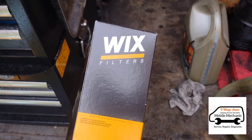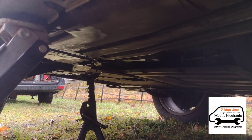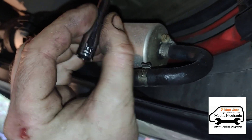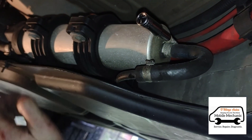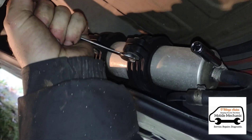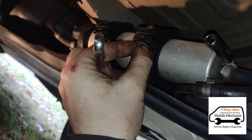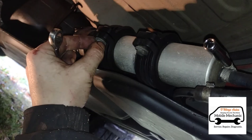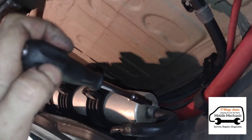Lastly, we've got the fuel filter. We've got this front corner jacked up, and I'll stand just underneath the wishbone arm. Here we are underneath between the front wheel and the back, just in the centre — and there you've got the fuel filter, just a long tube canister. I've got a quarter inch 5mm socket to go onto that little clip, and here should be 10mm. I can open these by turning anti-clockwise to loosen up the clamp of the canister.